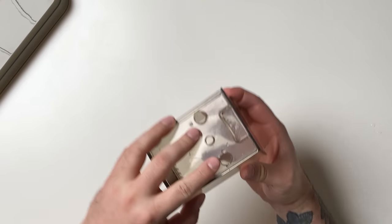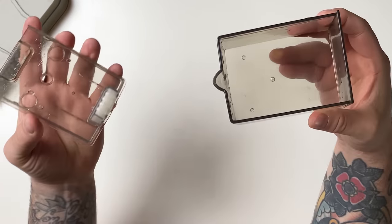A couple of things to note: the top holes in the water tank seem like they'd be for gripping the lid, but adult fingers certainly won't fit in there, so you'll need to grab the lid by the sides. Also, the only way to remove the water from the tank — without tipping the machine upside down, which I don't recommend — is to start the drying cycle, which triggers the draining cycle. Only use distilled water, as tap water will calcify over time and cause problems to both the machine and your records. Make sure you have water in the top before starting the cleaning cycle — it happened to me. While there is a safety feature that won't allow you to run it without the lower tank in place, there is no alert that prevents you from running the machine without water in the upper tank. I feel this is a huge oversight that can certainly ruin your machine.